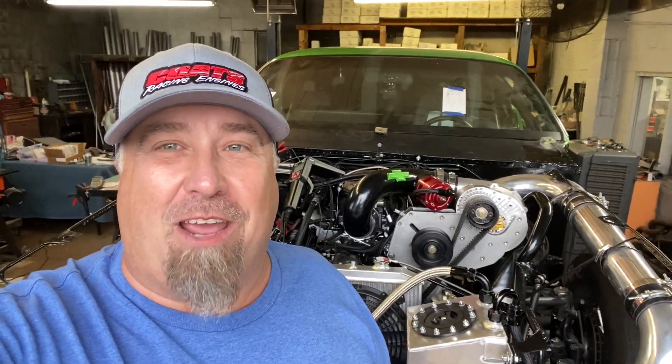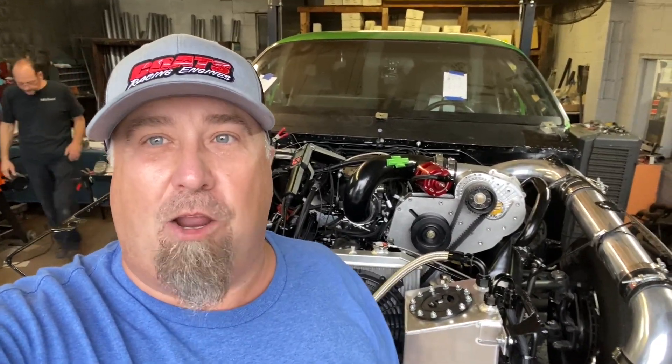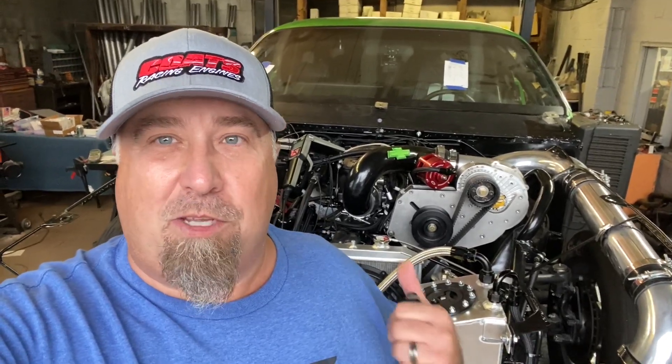Welcome back to the YouTube channel. We're over at the shop at Mike's today. This is the Challenger that's got the LS motor. Last time it was on the dyno it was losing crank sync — the same issue mine's having. Let me show you what he's done. He got it fired up but we think there's a little bit of an issue with the reference angle.